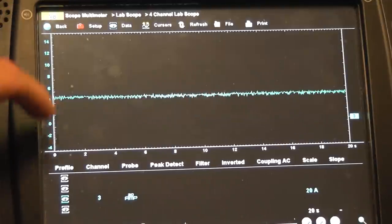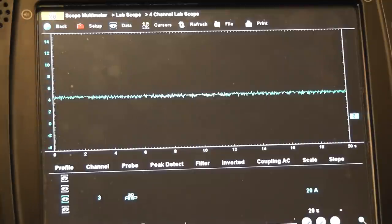Addressing the amperage spikes we were seeing on screen: if you have a DC electric motor with brushes being turned on and off rapidly, you will get large amounts of voltage and current spikes every time it cycles. This has to do with counter electromotive force. When you first turn an electric motor on, there's really no resistance — the motor has to spin up to create resistance. You can blow a fuse by rapidly turning on and off a DC electric motor. I believe that's what's blowing the fuse on this circuit.